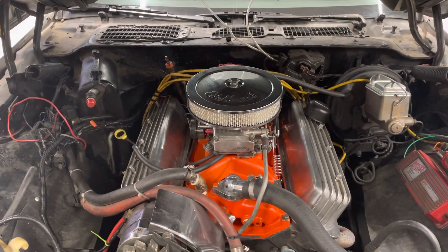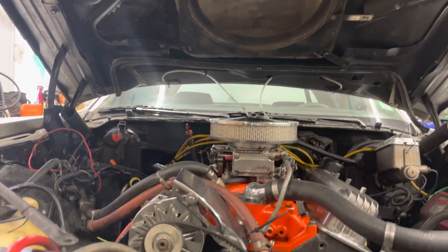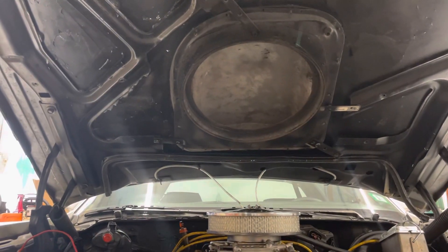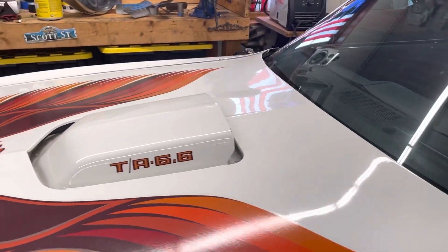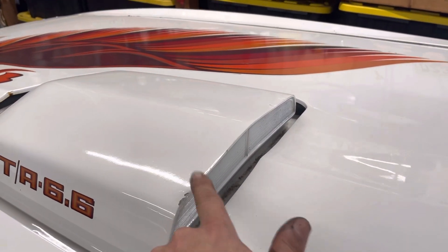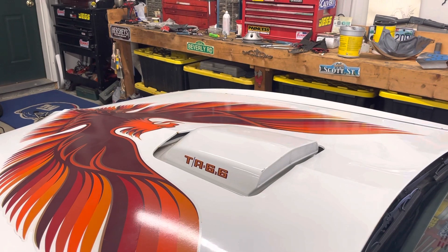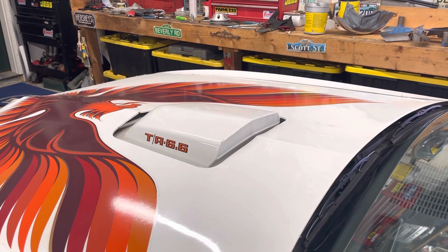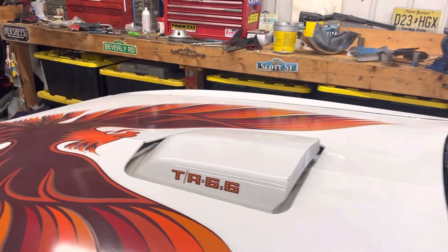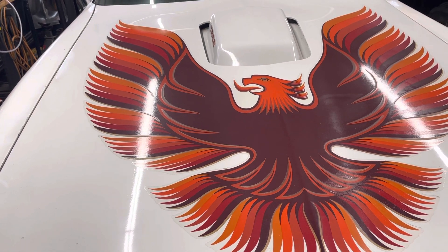One of the reasons I'm looking at getting rid of the shaker hood and doing something different is that I bought this high-rise intake and the air cleaner's kind of small — it goes up in there and there's no way for it to breathe. As you can see, it's not a big block 6.6 and there's no way for this to breathe. If the car were running down the road, wind would be coming through for cross ventilation to the air cleaner — but maybe we should drill some holes in that, make a honeycomb pattern, or cut it out completely and just have an open slot. You let me know — this is your time to comment, because if I do it and you don't like it, well, you didn't tell me. Thanks for watching — like, share, subscribe and I'll see you on the next one.